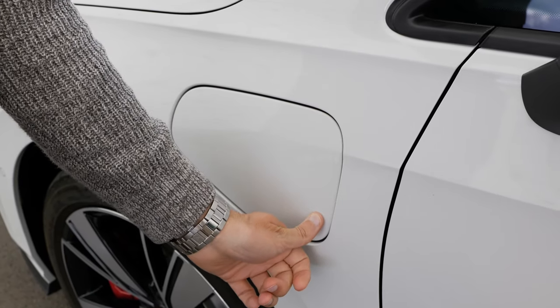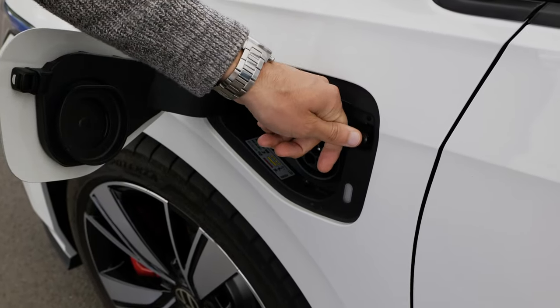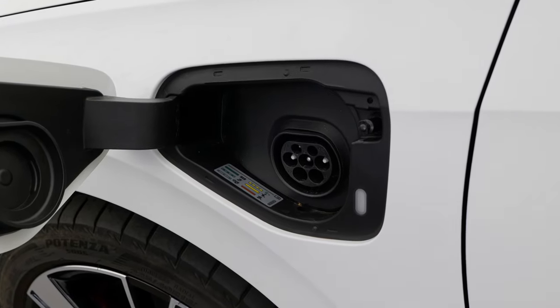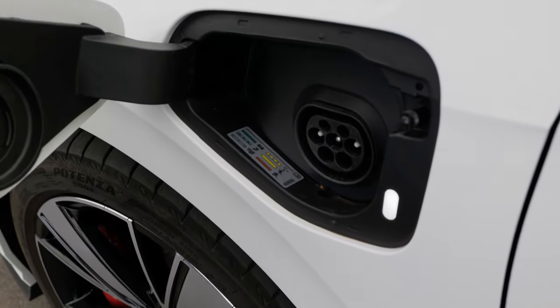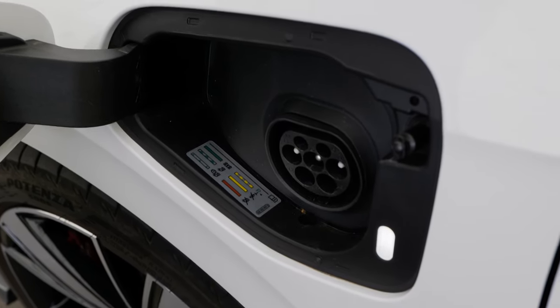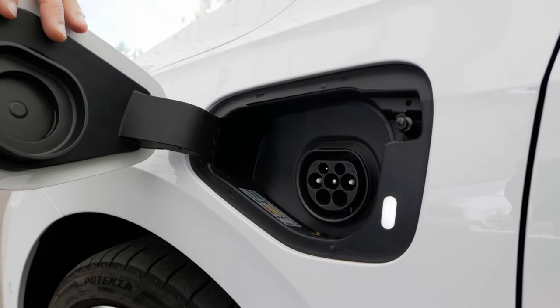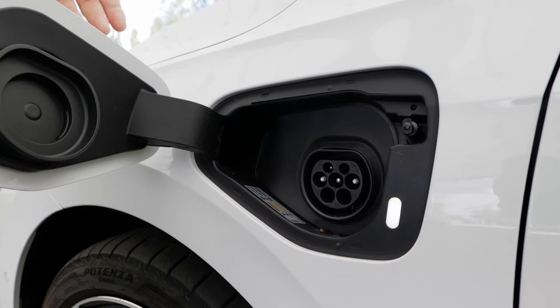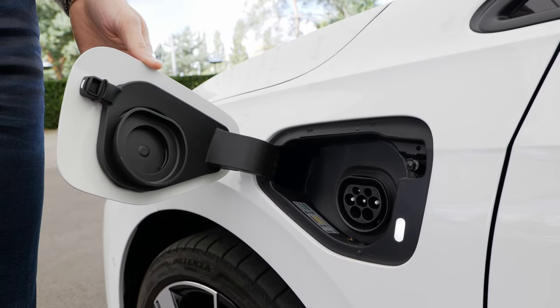Most importantly, 13 kilowatt hours is now the battery capacity — more than before — giving more pure EV range: around 45 kilometers, a little less than 30 miles, pure electric. For recharging, the charge port opens by pressing exactly on the pin line. Charging is 3.6 kW AC only, meaning from zero to 100% takes about just under four hours from a wallbox. With plug-in hybrids, you usually plug in at home overnight and it's full.